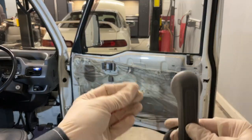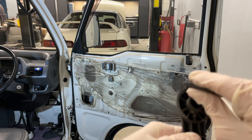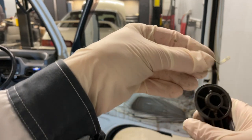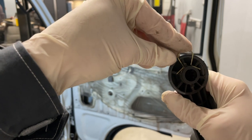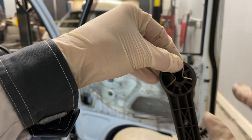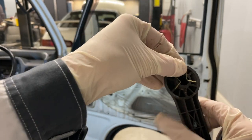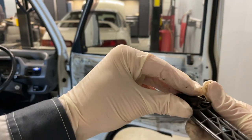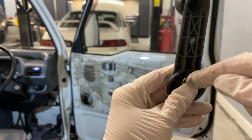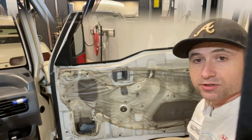I'll share how to get the door handles off. On the back side it's splined, and you've got a little spring clip that sits in there and covers the diameter of the hole. You've got two options: if you have the proper tool, you can come from this side and spread the clip to slide it off. If not, look on the underside and use a very small flathead screwdriver to get underneath it and pop it up — then you can slide your door handle off.